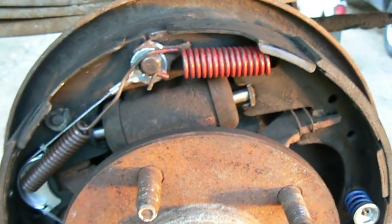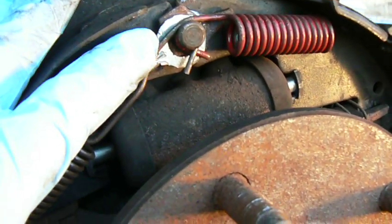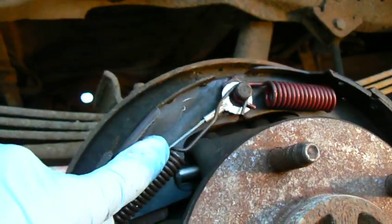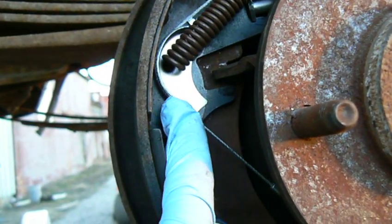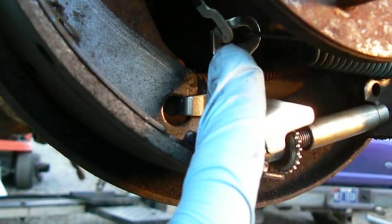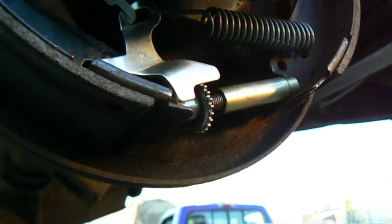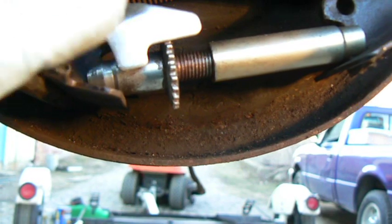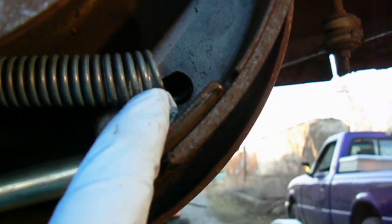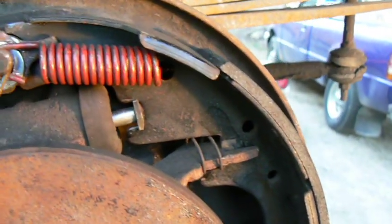We'll make an anti-clockwise circle starting at the top. Note that the eye of the adjuster cable starts here and that it winds around this half-moon channel and on down to a slot in the lever. The same slot also connects to the bottom spring. The lever presses against the cog of the adjuster screw. Here's the other side of our bottom spring, and on and back to the top.